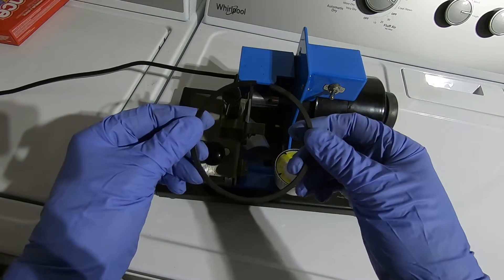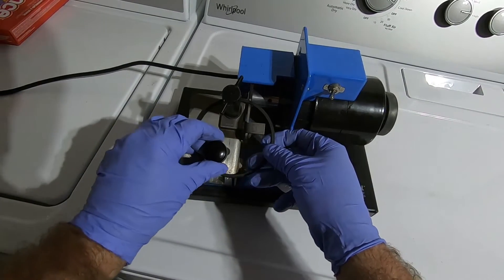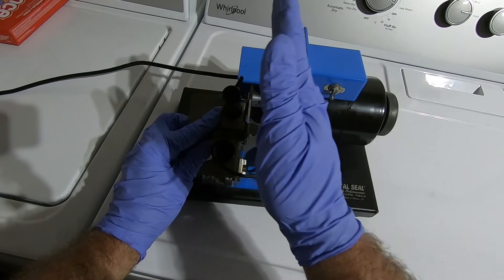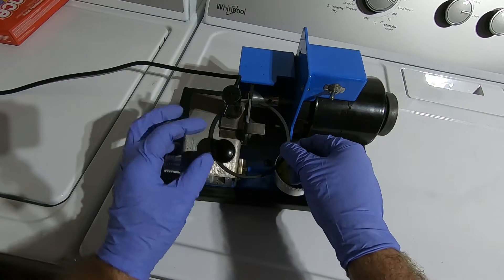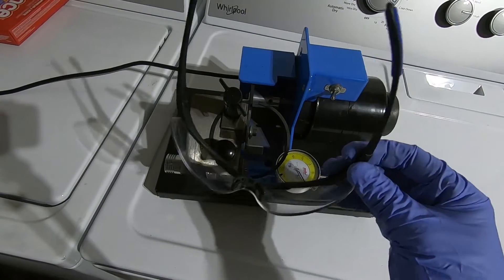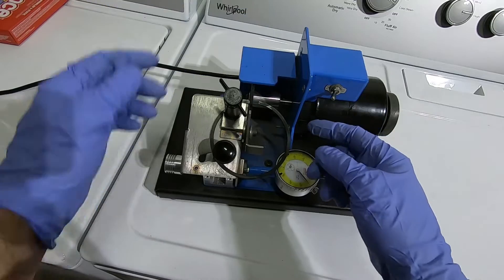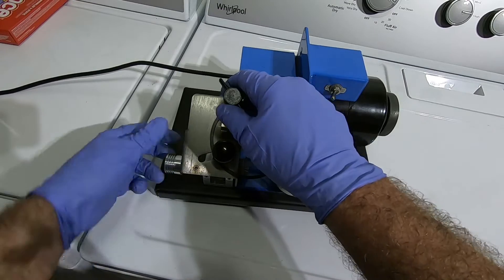This was set up for a larger bore piston last time, so I need to move the stopper so the edge of the ring is parallel with my grinding wheel — that way when I start taking material off it goes straight across. I'm a big fan of eye protection. Once I start grinding, I'll move this knob to move the ring in and out up against the grinding wheel, and I do it in an up-and-down motion as I'm turning the wheel.